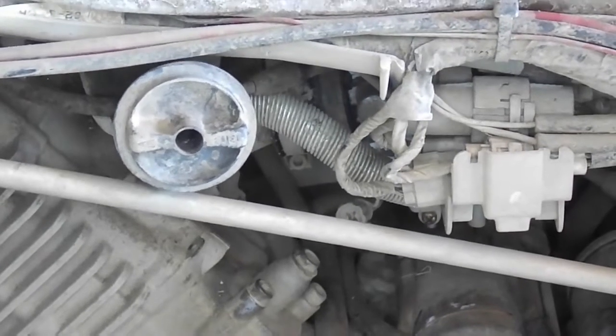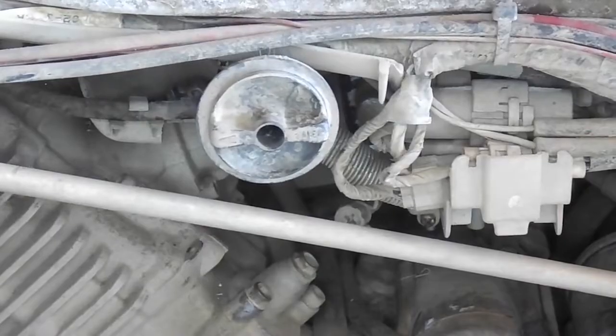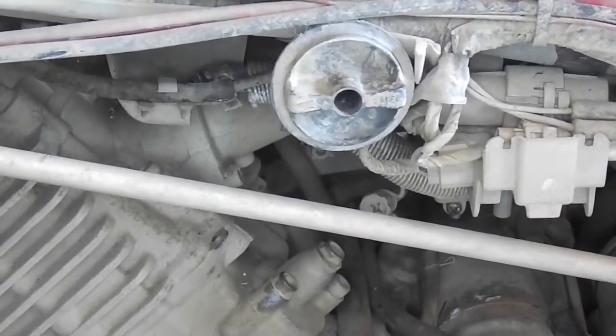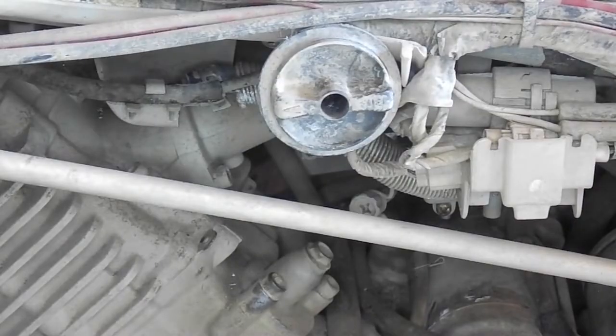I did not zoom out here so you can see how the fuel shutoff comes out with the tank. So when removing the tank, you have to be careful in guiding it out without breaking it. It will take some patience and some wiggling, but it will come out.